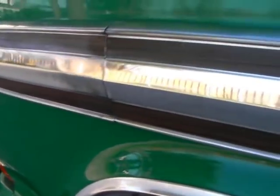I used some 320 wet paper and sanded it down through whatever they put on there — lacquer or something. Then if there were any scratches from that, I went to 400, then 600. It didn't take long at all. And then just a buffing with the Mother's, and that came out good.